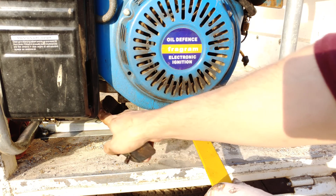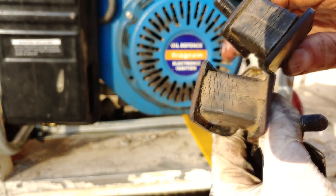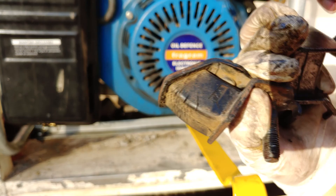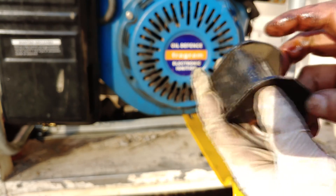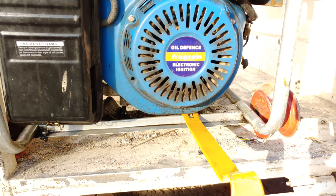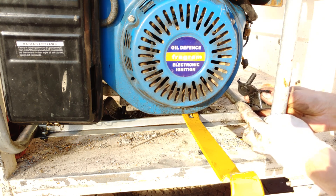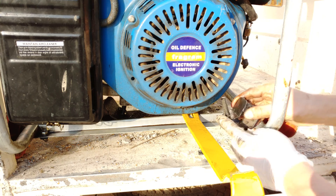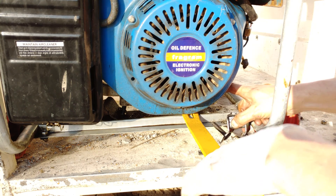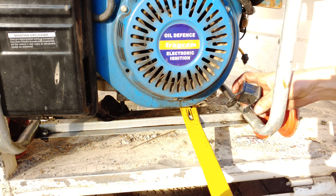You have to loosen both sides, otherwise you might tear the other mounting. Looking at these mountings — these are the broken ones — you can see they're torn. Looking at the new one, it's pretty sturdy; I can't even compress it in my hand. To put it in, line it up and get it ready. You can see the orientation: there's the lip which is going to seat in one of the holes, this one going into the block, and the threads going through the frame.